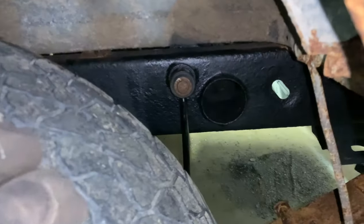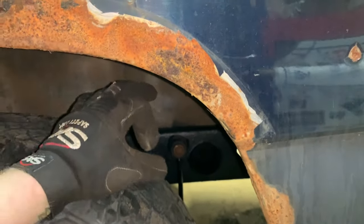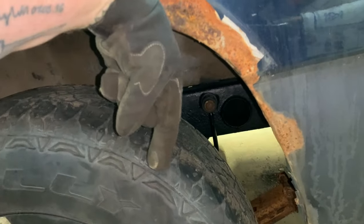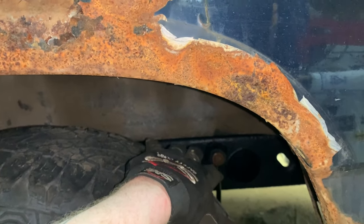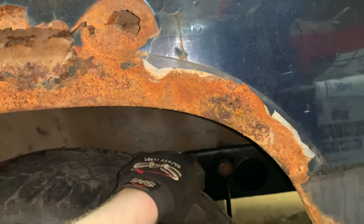Well, I got her on the ground, and jeez man, the link is just about perfectly vertical — that's great. What a nice look. One thing I noticed when landing on the ground: as the weight came into suspension and it started to settle, I could hear a grinding from that bushing freaking out. That's because I tightened the bolt when the rod was angled, and now the rod is vertical and there's load on that bushing — that's going to motivate the rubber to tear away from the steel bushing and wear the link out quickly. So I'm going to loosen it to take the load off, then tighten it back up. I'll just do that off camera — it's just loosening and tightening a bolt, no big deal.